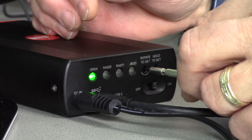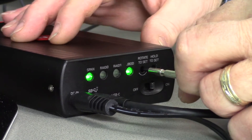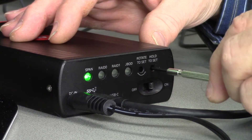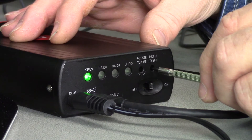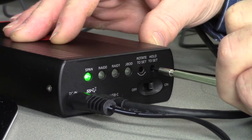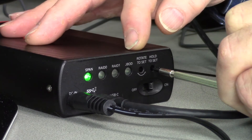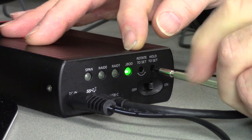In this case we are going from what was our span mode to our JBOD. Once you have selected your new RAID mode, press and hold to set — it's a little momentary push button. As you depress it, just wait until it changes; it will go solid, and that means it's changed.